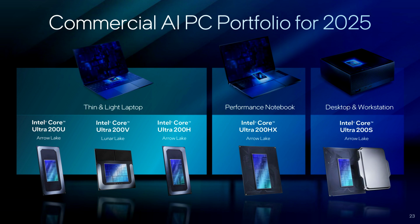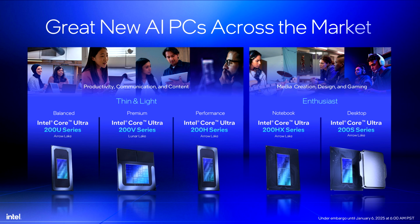Select Intel Core Ultra 200HX SKUs will offer overclocking options to further tune performance, with key features including compute overclocking for P cores and E cores, Intel Extreme Memory Profile, XMP, support for DDR5 SO-DIMM overclocking. New overclocking interfaces include die-to-die and fabric, and controls like 16.6 MHz ratios. Intel Extreme Tuning Utility comes with one-click overclocking using the Intel Speed Optimizer feature.